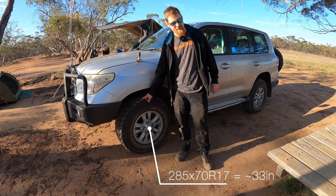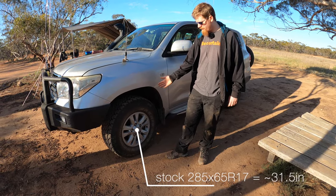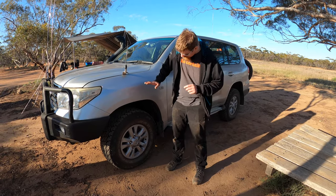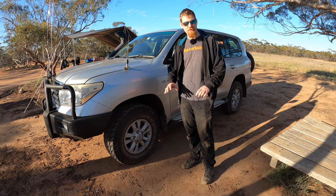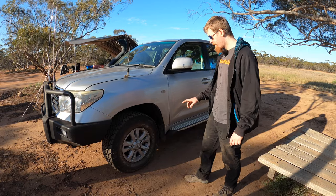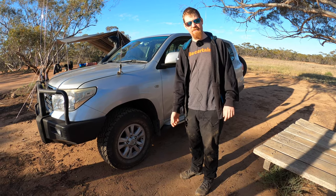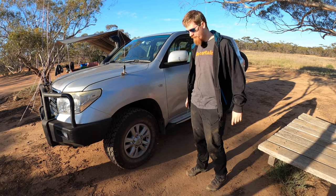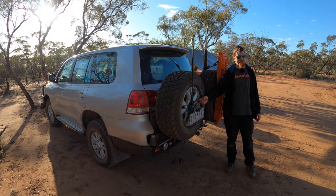You can't actually put 16s on the front here — they won't clear the large front brakes. The tire size we're running is 285/70 R17, which is pretty much a 33-inch tire. The stock tire size is a little over 31 inches. Upgrading the tire size makes any bump you drive over smaller relative to the tire, lets you drop the tire pressure more before endangering the rim, and it's actually the only way to truly increase ground clearance. You can lift the suspension all you like, but since the rear is a live axle the diff will be exactly where it is between the two wheels regardless of suspension lift.